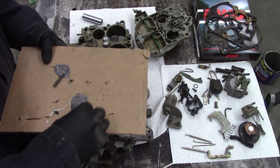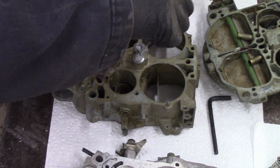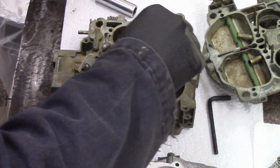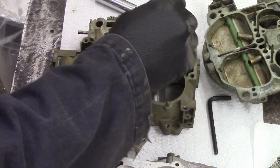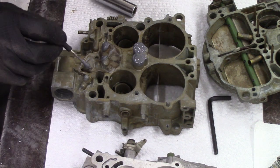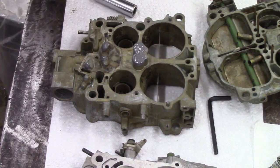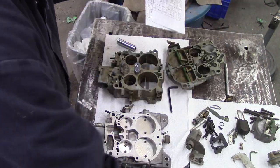This is one of the methods of sealing up the pesky leaking plugs on the bottom of the Rochester. I don't see evidence of these ones leaking, but it can work. I have seen folks grind out the lead plugs and then thread them and put set screws in to seal them up, and I think that's a better way to go. This carburetor is going on dead engines in the school shop, so I'm not worried. They do leak through those little passages in the base plate and you get a rich mixture.